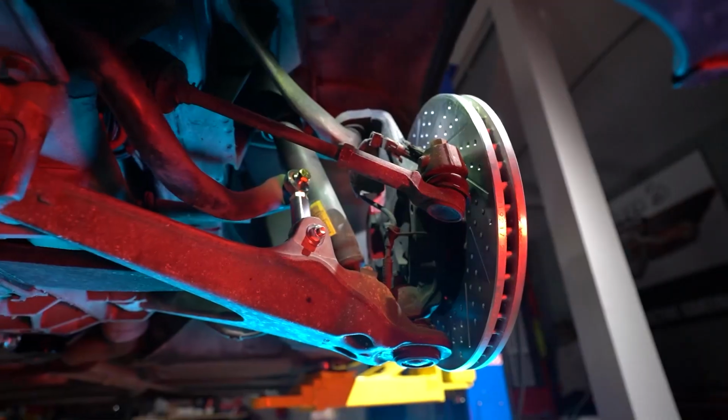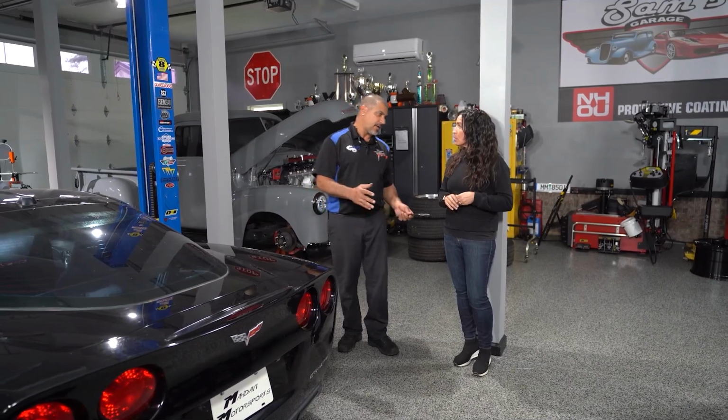It looks fantastic. And it's also really important to remember that when you do new brakes, you have to go easy on the brakes at first. So never go out and slam on the brakes. You have to ease into them for how many miles? Roughly 50 to 100. You want to break it in easy, up to 300 really, depending on what size brakes you have, what kind of compound you have on the brake pad itself. Yeah. And now we can put the wheels back on the truck. Where they belong. Yep.